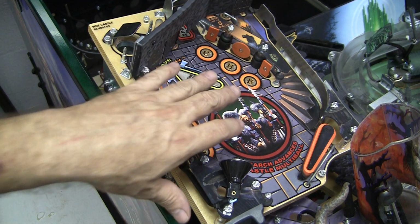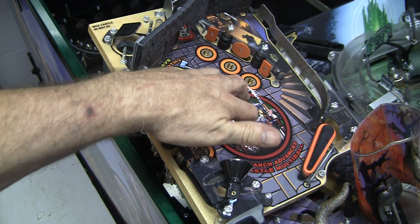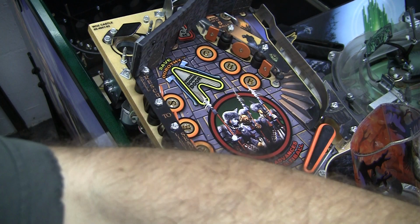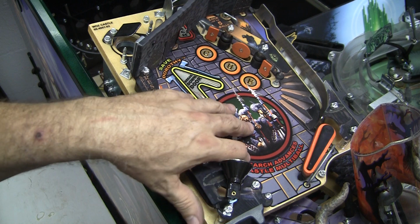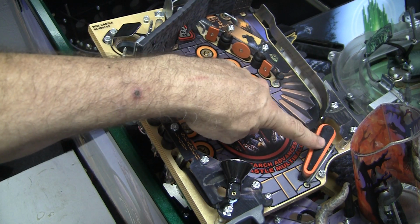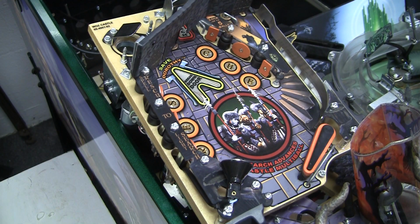And when you do that, it starts playing O-E-O and doing all of the stuff in the upper playfield. But what I was running into was the ball was not even up here. The ball was in the lower playfield, and these switches were triggering, and it was throwing the whole game off. One of the big problems with this is these upper playfield flippers are not disabled when you're playing the ball normally on the lower playfield.